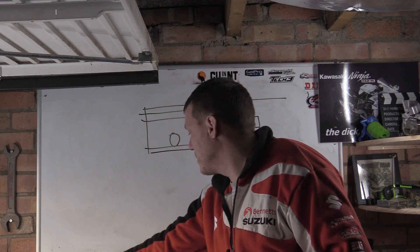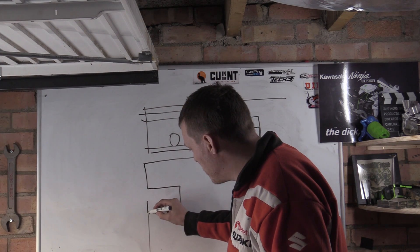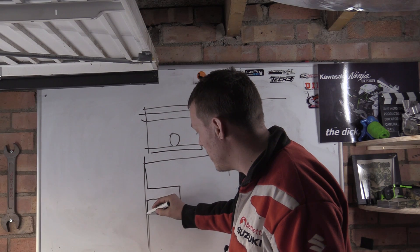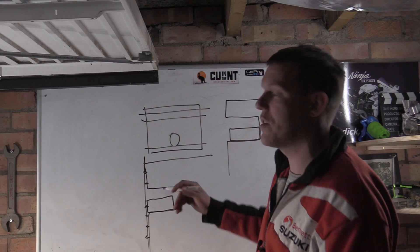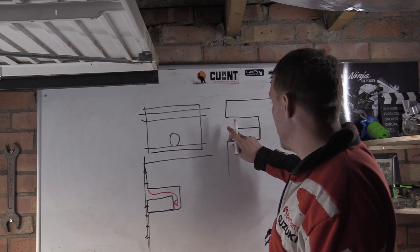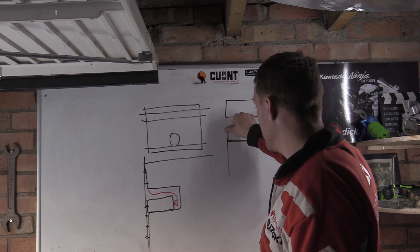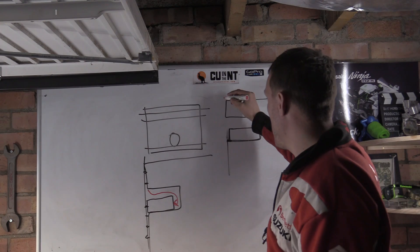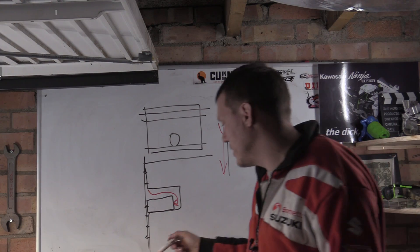The reason is you need to be able to get the gases behind the piston. If your piston ring groove is like this, and your ring and piston are basically level because of piston slap, now you've got your cylinder wall and they're both making contact. There still needs to be gas pressure that can get behind this ring and force it against the cylinder. If you had a ring that basically butted up to the back and went flush or sub-flush with the cylinder, once this piston moves away from the wall, the gases would just blow by, and the gases would actually seat the ring and hold it there — so your ring is completely useless as a sealing element.